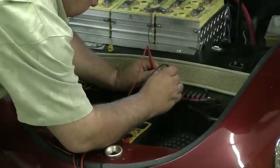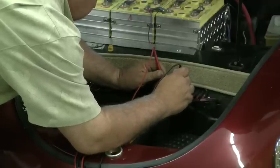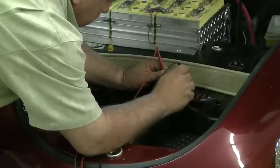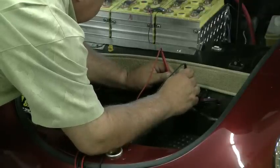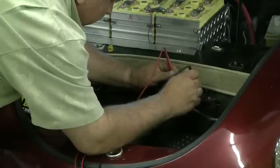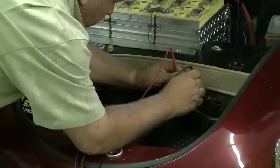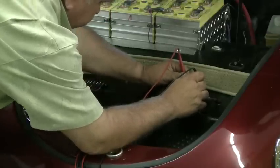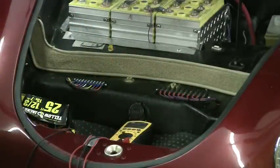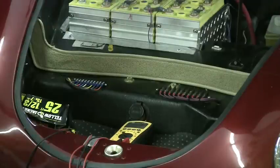I'm going to compare battery number nine, which is 13.41 volts, with battery eight, which is 13.40, with battery seven, which is 13.40, battery six, which is 13.43, battery five, 13.42, four is 13.43, three is 13.41. We can see that at rest right now, these batteries have a variation across four cells of three one-hundredths of a volt.